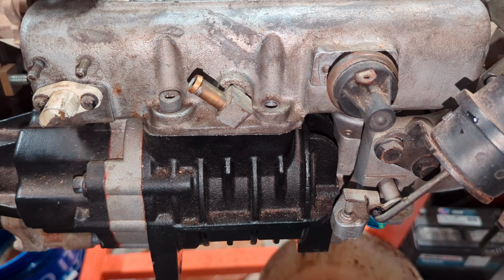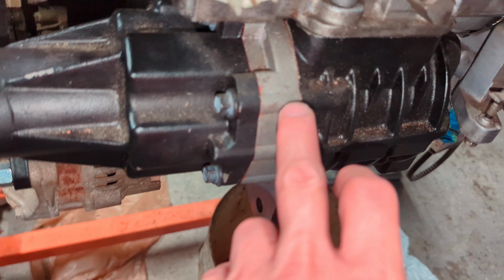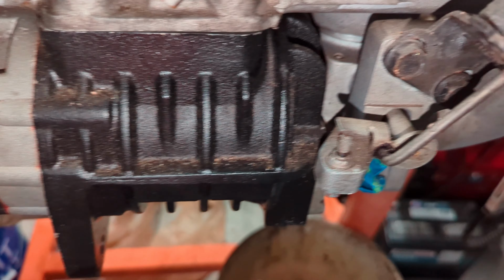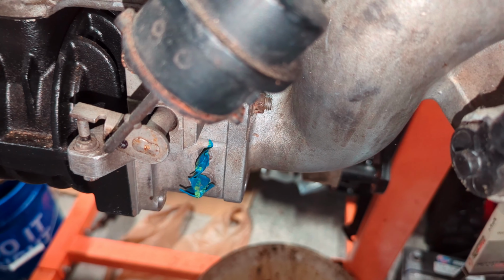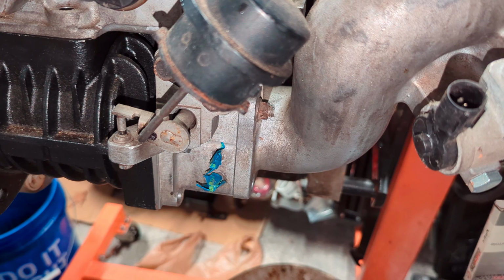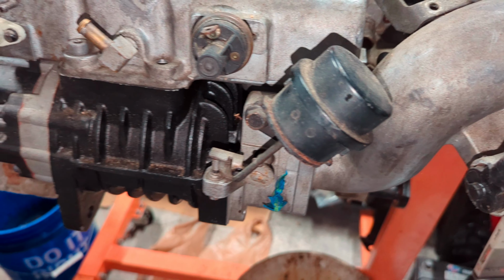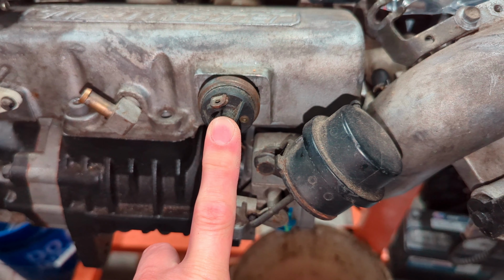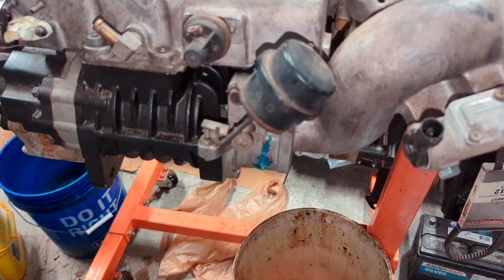Another thing that you're going to have to worry about is gaskets. The major thing is using anaerobic sealer around the actual housing area here. And any of these gaskets that run in between the throttle body and everything, you can just pick up some fiberboard paper and make them yourself. Just cut them out. Real easy. Simple to do. We'll get rid of this because we'll be running an aftermarket ECU, probably an OBD1 swap. Other than that, that's really all the major things.